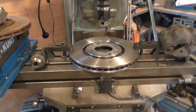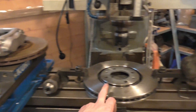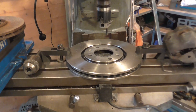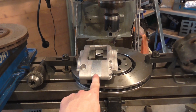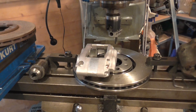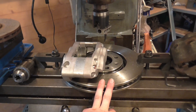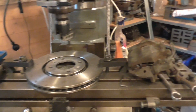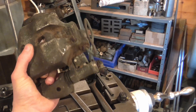The issue is a 22mm thickness like the original Toyota-derived Lotus disc, rather than the 26mm of the Citroen disc. This isn't particularly a problem — I'll just order a new set of caliper spacers from High Spec to suit the 26mm disc. The disc is a chunk heavier, but the caliper is considerably lighter, so I'll probably still get a small reduction in unsprung weight over this cast iron monster.